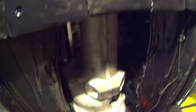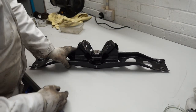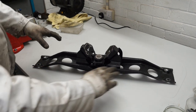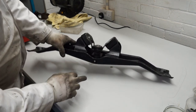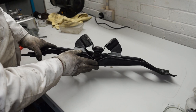As you can see, I've just got the crossmember resting across the chassis here. When I remove the gearbox in a moment, what I'll have to do is lift this assembly up with a jack so that it will clear this part of the chassis. So here's our crossmember on the bench - most likely it'll look different to what's in your car because this has been drilled out just for racing purposes to make it that little bit lighter.